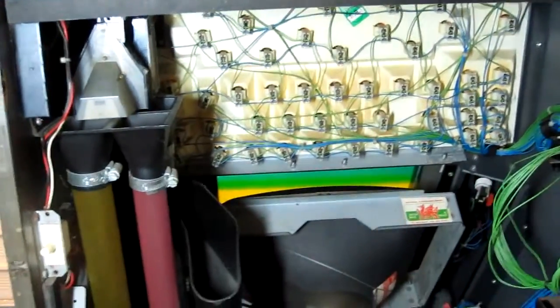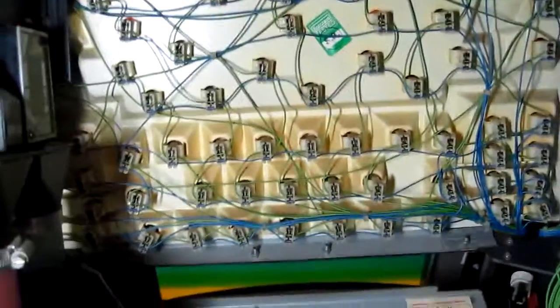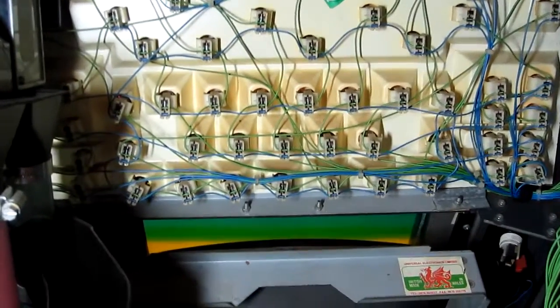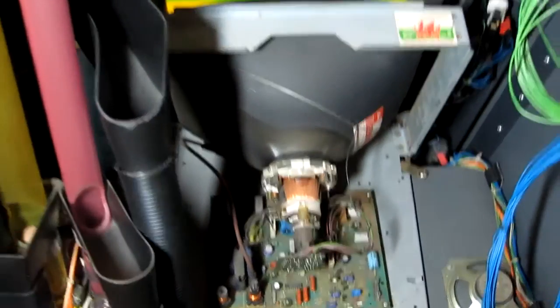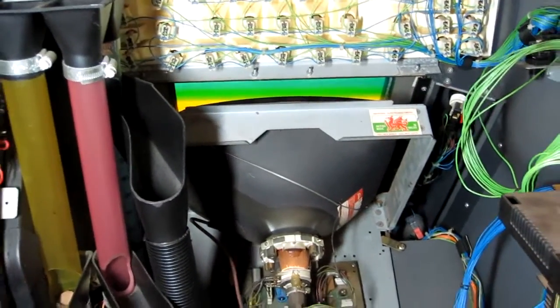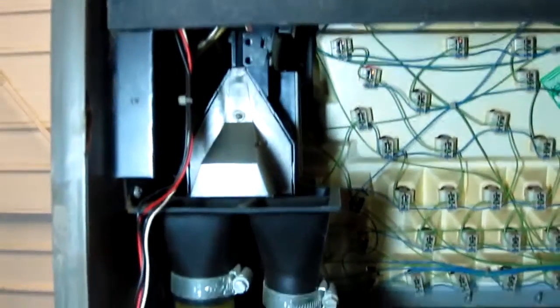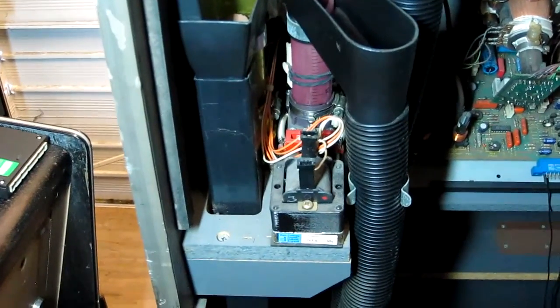Right, let's just have a quick look in the back of this machine and see how it all goes together. So we've got the light board here at the back which illuminates the back glass and the instruction cards. We have a 14-inch black and white monitor — that's a proper black and white with the colour overlays as you can see. This is the payout mechanism: at the top we've got the coin mechanism, the coin sorter, the payout tubes which store the money, and the payout slides which push the money out of the bottom.